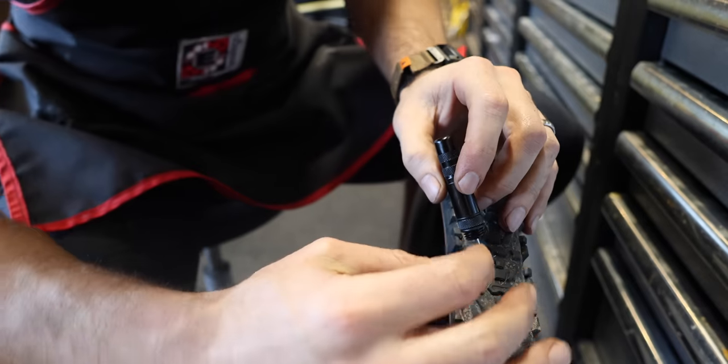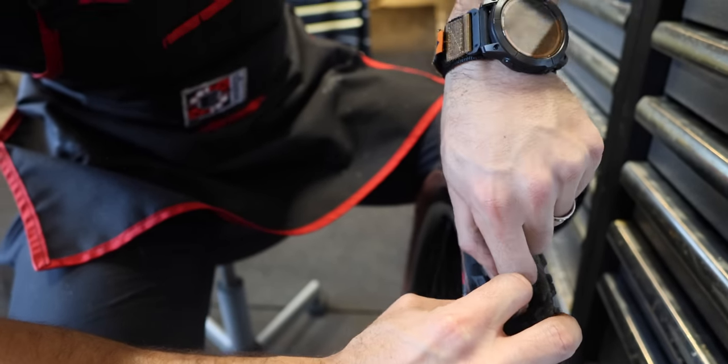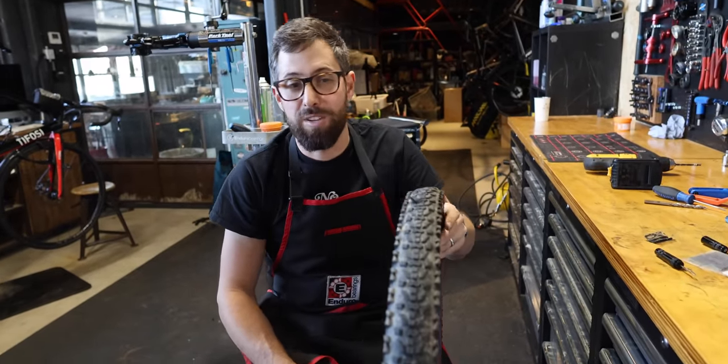Find your hole again, push it in with control until there's only a little bit sticking out. Spread them apart, hold it there, then pull straight out — those bits stay in there, you don't have to remove them. Re-inflate your tire and off you go.